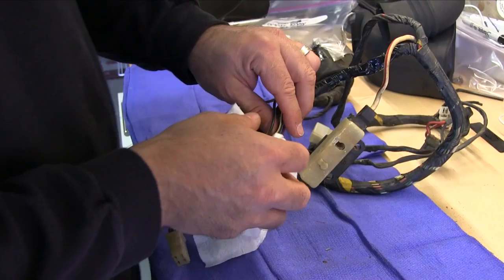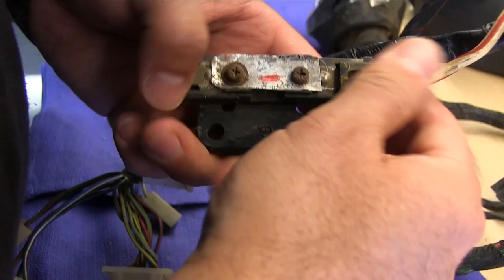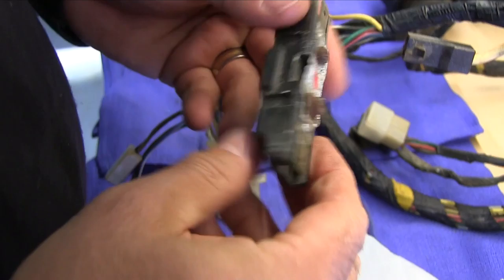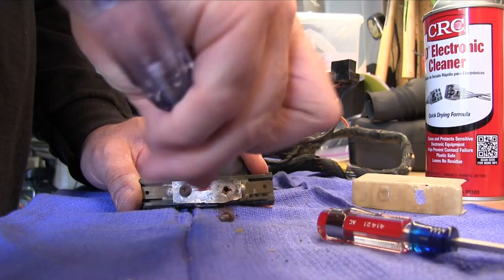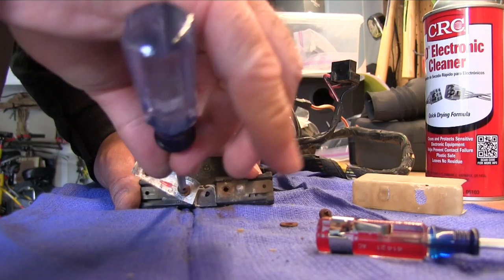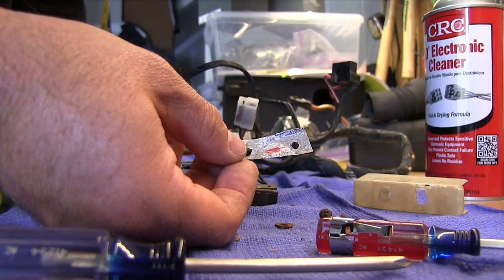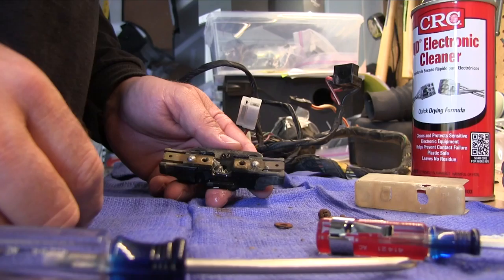Pretty much wiping everything down, getting it cleaned up. I've got electrical cleaner hitting the plugs. Look at that — that is not stock. Someone's been monkeying with this before. Well, there's something I gotta fix. I can come up with a new fuse; I've seen them available at a couple of places. That is not stock — someone rigged it. How hard is it just to go get a new fuse? They're cheap, even today when the car is a trillion years old. Just a piece of aluminum. Looks like it's from a Red Hot Chili Pepper. I'll clean this up, use it again, put a new fuse between there.